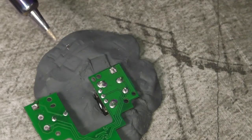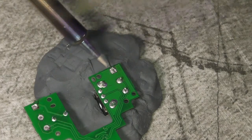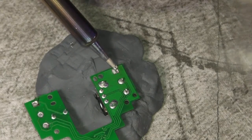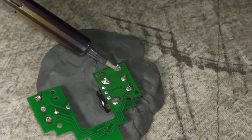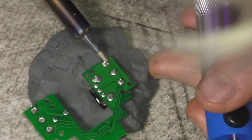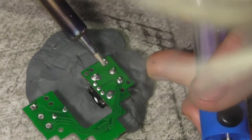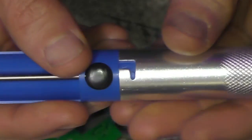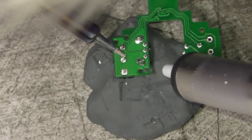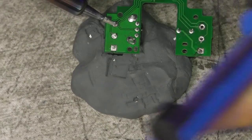What you want to do is leave the iron on there for a second and wait until the solder melts — you'll see it turn to liquid. Then put the pump over it and press the button so it sucks it up. Some solder will come off and get stuck to the tip of the soldering iron — you can use the pump to clean the tip off too. After a while, little bits of solder will fall out of the pump back onto what you're working on. You can take the pump apart and empty it out when that happens, just get most of the solder out.